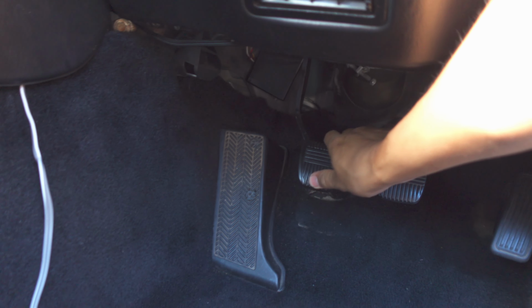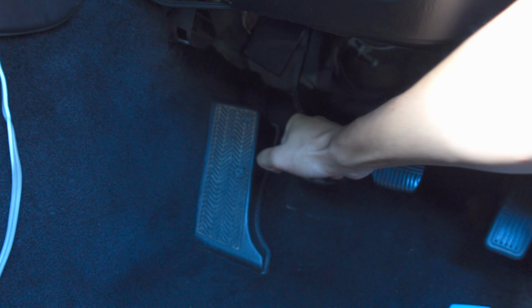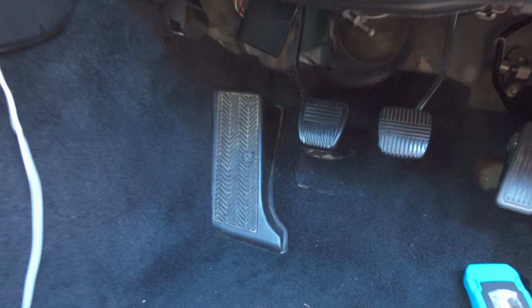Okay, the final steps are pretty much here. The clutch, I don't know why it didn't work last time, but we bled it with a slightly different technique. I think there was air coming back in when we were pressing it back out, so we needed to open and close it much quicker rather than open it, let the fluid drain out, then close it. I think that was letting air back into the system. The clutch is ready to go, and just a little tester of that to show you. Press it in, it's quite heavy, and it springs back, which is nice and good.